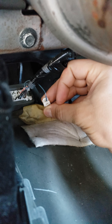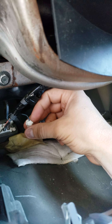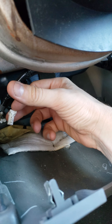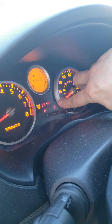Basically, you take that out and stick a paper clip behind that wire — shove it in there and make sure you get into the hole where the wire is, because there are more holes in there and the second one is empty. Once you get it in there, this is grounded, so you put the paper clip in here and ground it against this. Basically you're extending the wire to here so you can touch it. Then you turn your ignition on — not starting the car, just turn it on to the point that your lights light up on the dash. Then you have about 10 seconds to very quickly tap this six times: one, two, three, four, five, six. Your TPMS light right over here will start flashing.